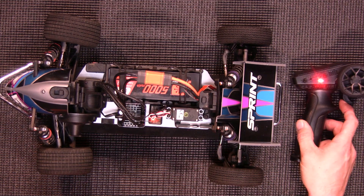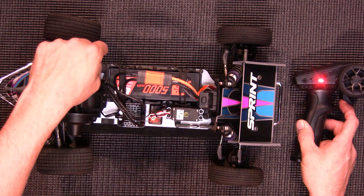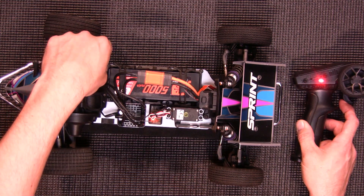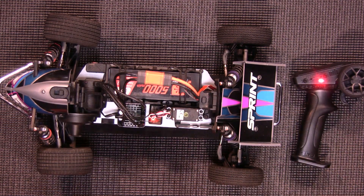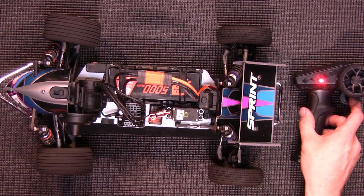Next is full brake, so you'll hold full brake and hit that button one more time. You'll see three LED lights flash — the setting has been saved and it'll synchronize. Go ahead and check it: there you go, we got brake and reverse.